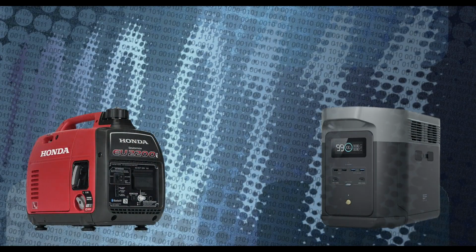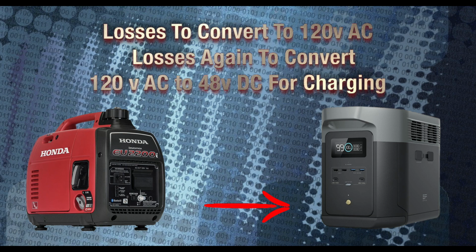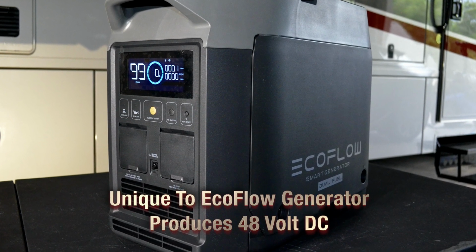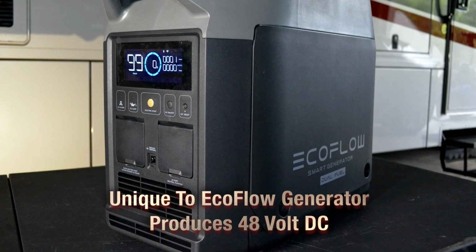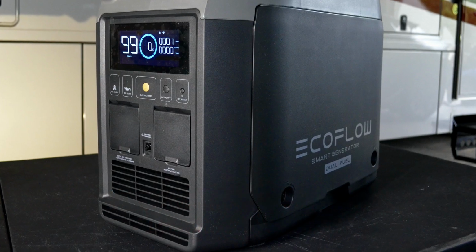Note that charging an EcoFlow power station with a Honda or a conventional generator will result in double inverter losses. There's losses from the Honda's inverter as it converts generator power to 120 volts AC. Then there's losses again when the power station has to take 120 volts and convert it to 48 volts DC to charge its own battery. Unique to just the EcoFlow generator is it produces 48 volts, allowing DC to DC charging of a Delta station, making it more efficient than, say, a Honda.